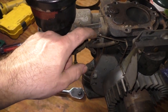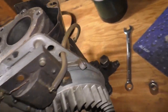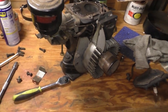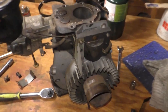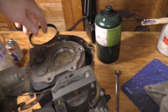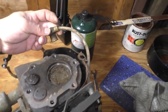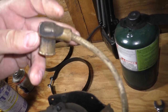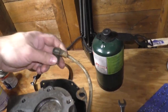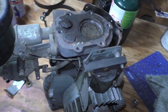Well, anyway, the first time I've ever looked at a 5S, let alone worked on one. But we think this is an early 50s, maybe, or late 40s. It's hard to tell without that damn date stamp. But we did confirm that there was no spark from the ignition at all. And that much we know. Yeah, this needs help. This wire needs to be replaced, the reason being the boot is completely chewed to hell. I never did check the oil level, so maybe we do that.